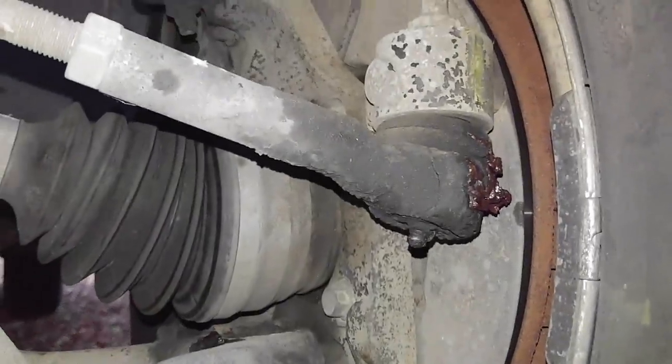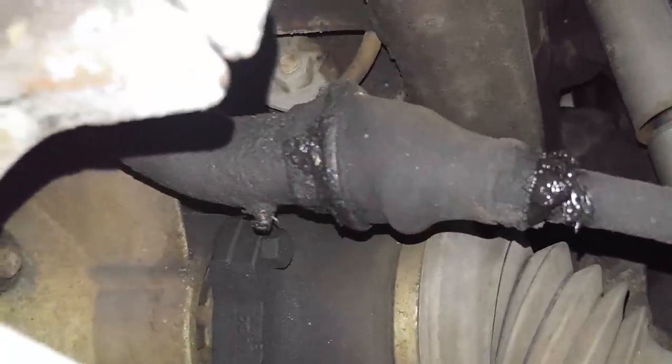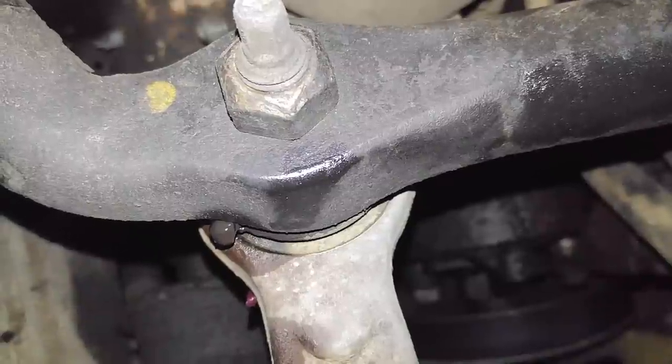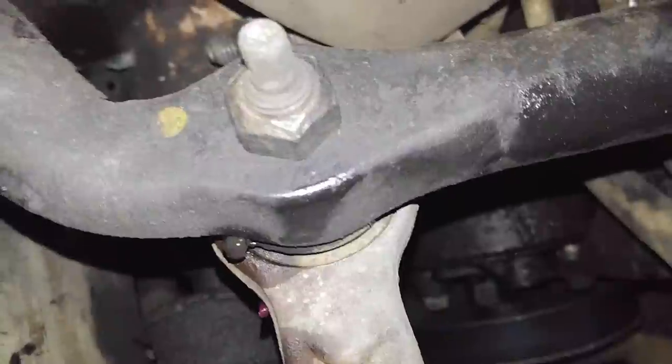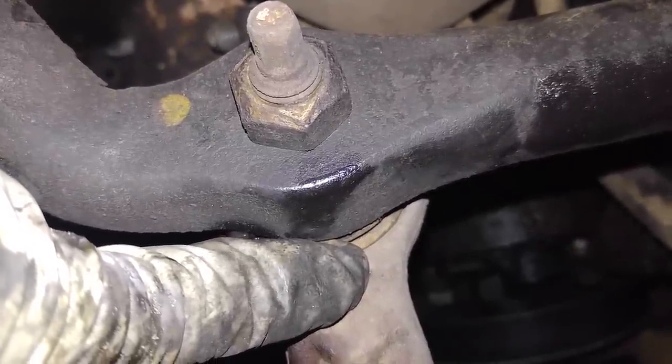Let's go over to the other side — the far side. Actually that's not bad because we've got a jack stand on that side as a safety jack. Jiggle-wiggle at three and nine. That seems fine — nice and tight. A little bit of play there. Where is that? In the pitman where it attaches through the center link. Do it again — very small, very very small amount.